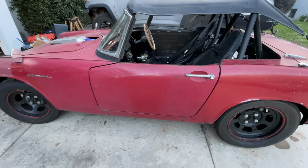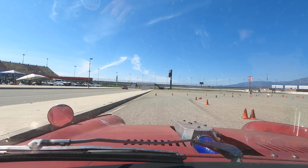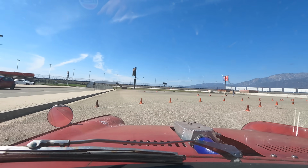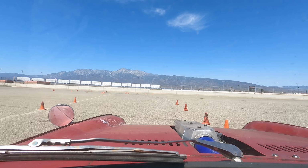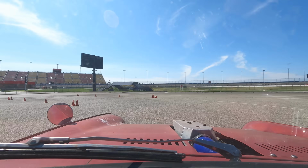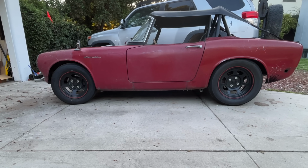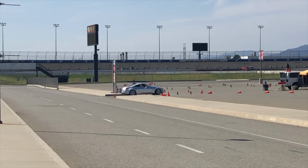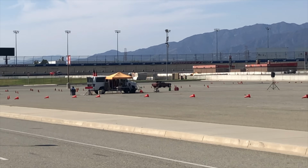As I said, this car is perfect for this kind of racing. It is excellent between about 20 and 120 miles per hour. Outside of that, it is not happy. Below 20, it has no power and has trouble getting off the line. The clutch is not used to trying to accelerate 1,300 pounds, and it tends to get really angry when you give it a hard launch. Above 120, it gets really scary since it has the wheelbase of a shopping cart and all the safety equipment of a shopping cart. Autocross doesn't get anywhere near 120 miles per hour, but it does start at 0, which became a little bit of a problem.